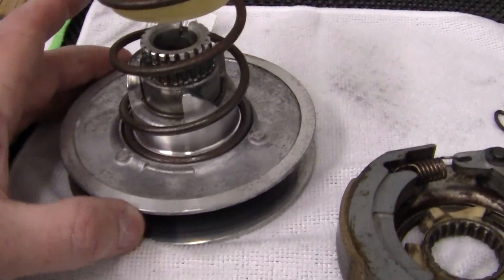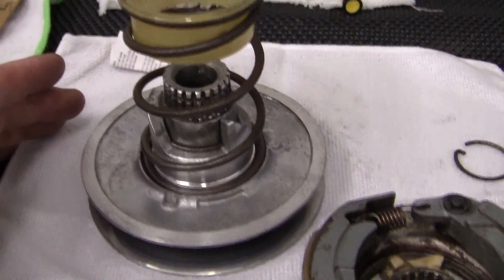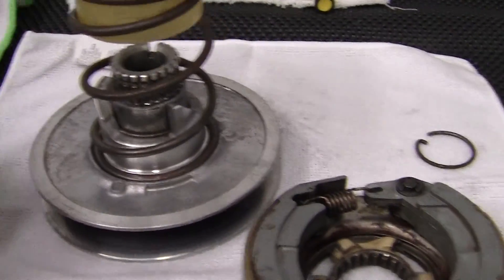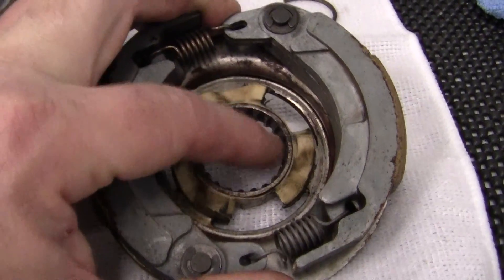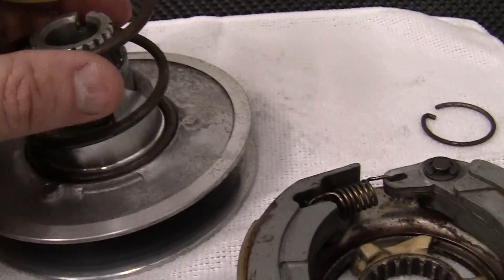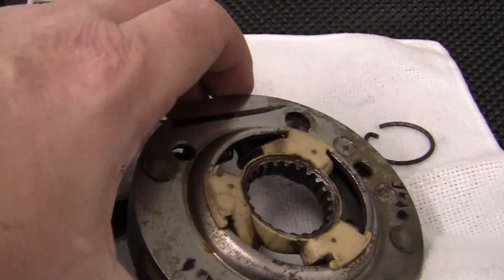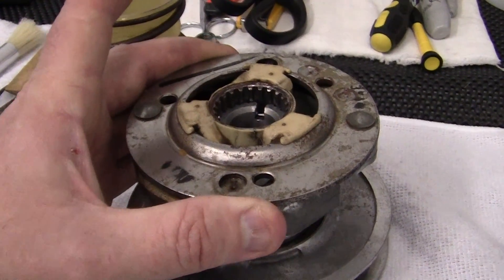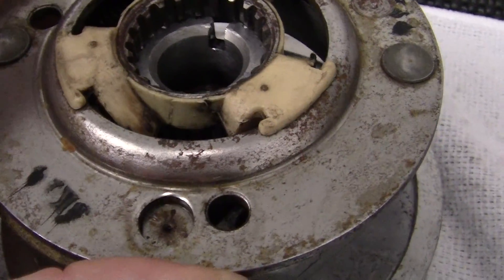Finishing off the clutch on how it works: the clutch itself — you can see the splined shafts right here, the splined gearing, this is the splined shaft. The clutch tips over like this, and it doesn't matter which way you put it, it will fit on the shaft here. We'll just do it without the spring to show you.